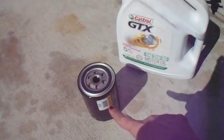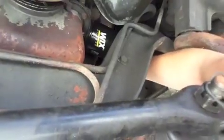And there it is. You know what I just remembered? We have to put oil in the filter. So I'm going to put a little bit of oil in there already so that we don't dry start the engine — I think that's what it's called. Fill the filter about halfway and put a little bit of oil on the rim too. Now just screw that bad boy back on. I'm going to put a glove on just to tighten this up a little bit, because the oil is a little slippery. You're going to want to make sure you screw that on there nice and tight.